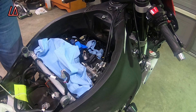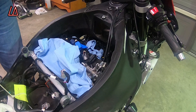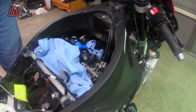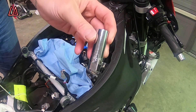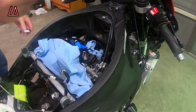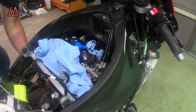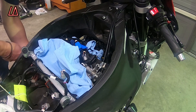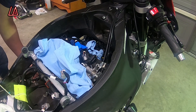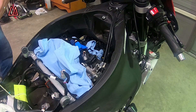Those markings are important because they allow you to find top dead center on all of the cylinders. Because my piston in question is in cylinder number one, I needed to find top dead center there. I'm going to let the video run a bit so you can see how I found the knock in cylinder one. You'll need a number 14 socket for the bolt I showed you earlier, and a wrench to attach to it, which will allow you to turn the engine.